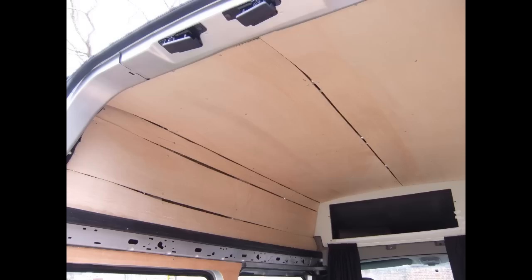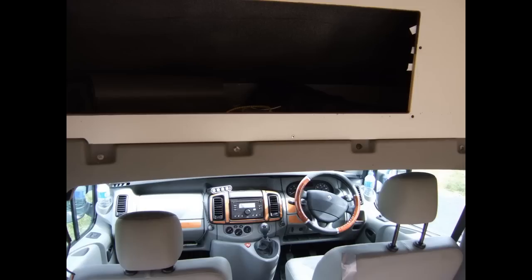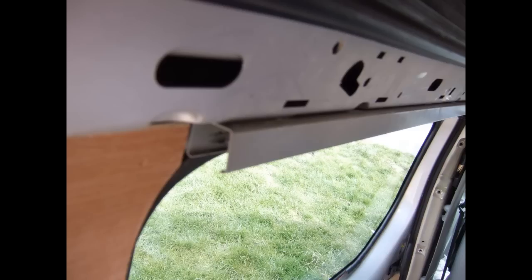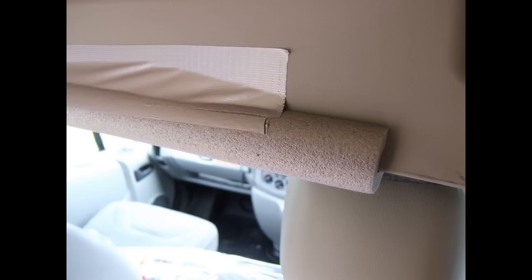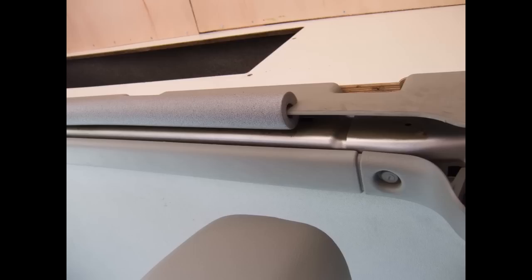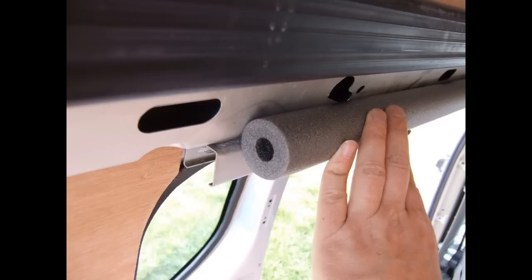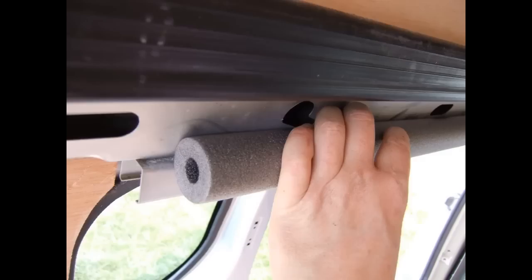The whole ceiling is now covered with four-mil ply. It doesn't look ideal at the moment but it'll all be covered with grey roof lining felt so you won't see any joins. On this particular van the side door doesn't reach the full height of the roof, so I kept smacking my head on the door runner. Before putting the roof lining on, I fitted some basic pipe lagging above the sliding door and also above the cab entrance, so the lining would cover it and give a soft, squidgy area to protect your head.